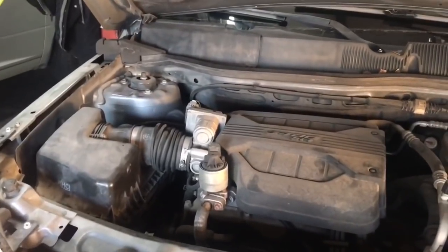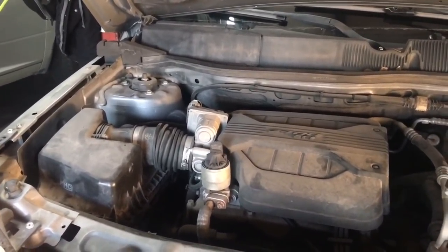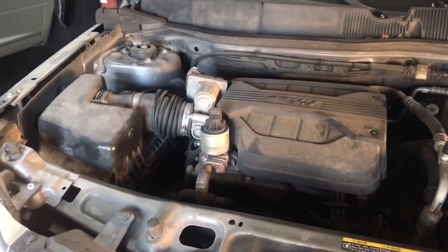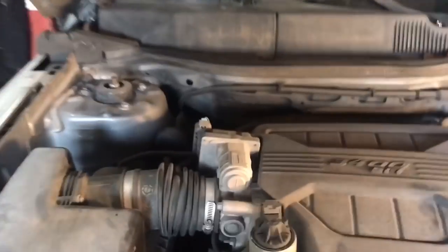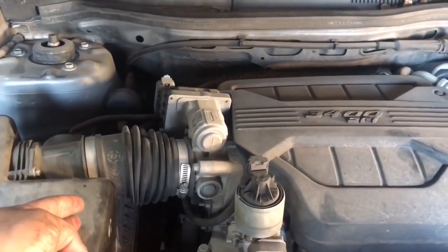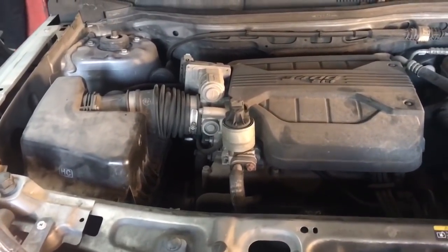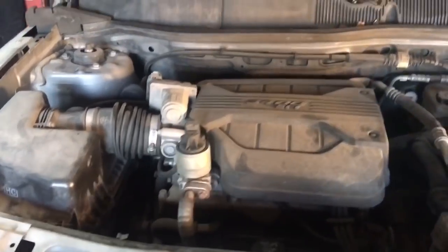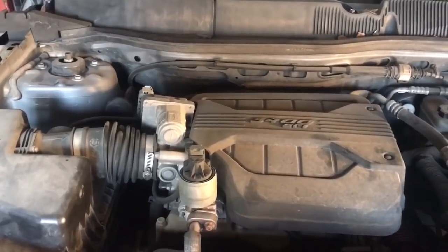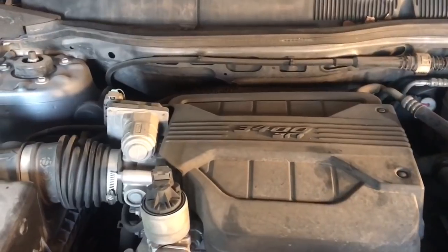To start off with, right here we have a 3.4 liter engine. To verify that this was the issue I fixed — a fuel issue — we actually opened up right here where the air filter is at and sprayed a little bit of brake cleaner, and we noticed that the car started. After doing some diagnosing, we went ahead and went straight to the relay. We tried to do a relay test just to verify that the relay was working, but we noticed that we weren't getting any power.